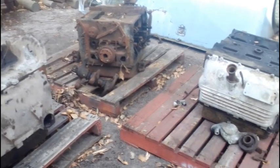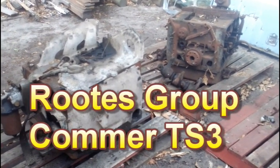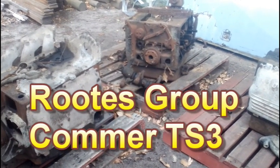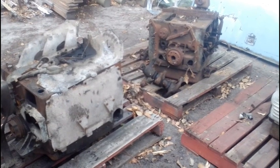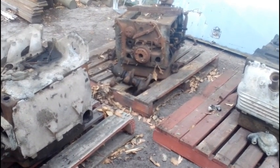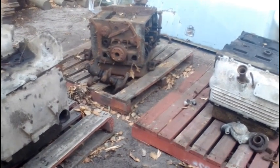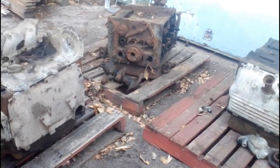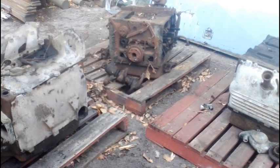These are Commer TS3 engines. The TS stands for Tilling Stevens. It was a part of the Rootes group during the 1950s and 60s. And these engines were installed into large diesel trucks. They consist of three cylinders, each cylinder consisting of two pistons horizontally opposed. If you have a look on my channel, there's more information on these, and I have one of these fully operational, and a video on the restoration of one.